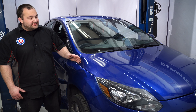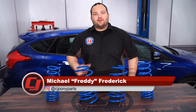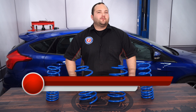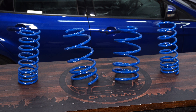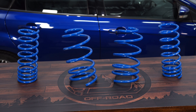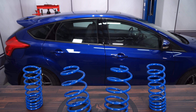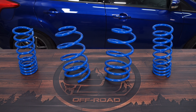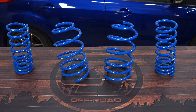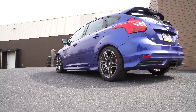Today on CJ Pony Parts, we're going to show you how to make your Focus ST handle and look better. The Focus ST is a great looking and handling car right from the factory, but there's always room for improvement. So today we're going to make our 2013 Focus ST even better by installing the Steeda lowering springs. These springs are designed to fit the factory struts on your Focus ST made before July 8th, 2013, but they'll fit most aftermarket struts for the 2013-18 Focus ST. They're going to directly replace the factory springs to lower the front of the car 1 inch and the back 1.4 inches, helping to lower the car's center of gravity to reduce body roll and understeer, as well as giving the car a killer stance. For more information and pricing on these springs, click the link down in the description. Now let's get to the install.